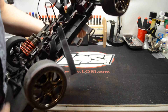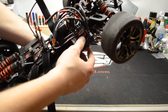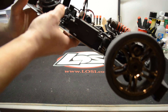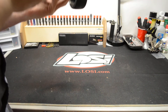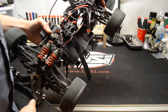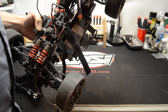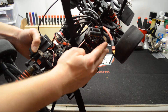I did upgrade the center — this is carbon fiber. I'm running the RX8, which is a very nice, easy-to-use speed control. I'm running the T8 motor, which is a 2650. I'm running a pretty big pinion — a 21 — with a 44-tooth spur, which is from the two-speed nitro version. Usually you can't fit it in there, but I made it work. I also have two capacitors wired into the speed control.